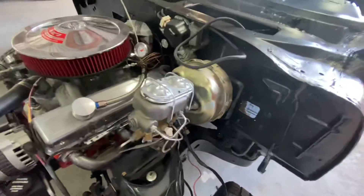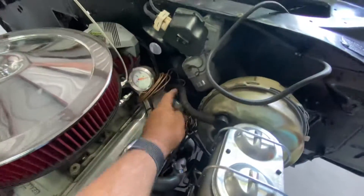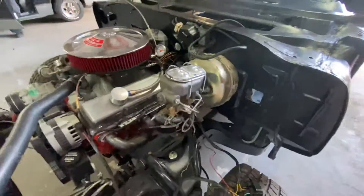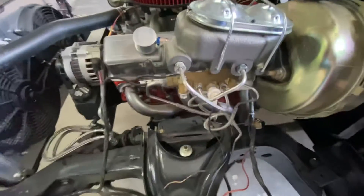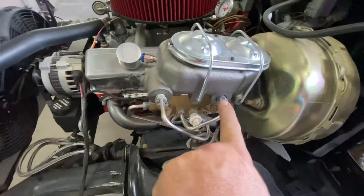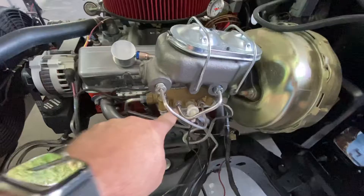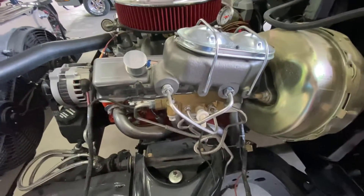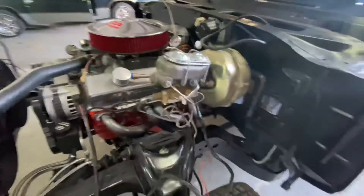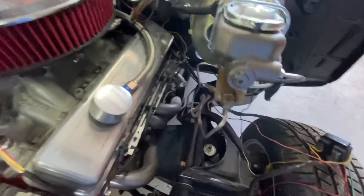The master cylinder and booster is installed with a booster hose. I still have to put a clamp on that but it's in. I had a little bit of difficulty because it's counter-intuitive that these lines cross. I was trying to hook the distribution block to here and there to there and it didn't work, then I realized I had them on backwards. Got it fit — looks good. Now that it's all mounted up, the lines don't interfere with the headers although they're tight.